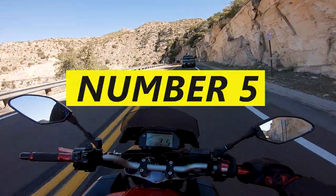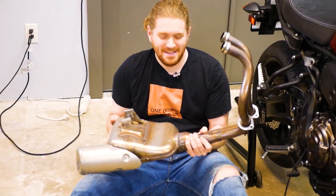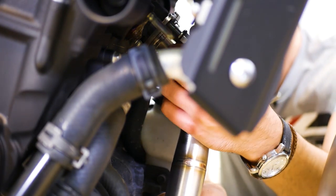This goes hand in hand with my next point, and that is simply to think. Before you pick up a tool, think: what am I doing? What am I trying to accomplish? Or what will happen if I remove this bolt? If you're installing a full system exhaust on a modern sport bike with a one-piece exhaust system like the CB650R or XSR700, pulling that last supporting bolt out will cause somewhere between 15 and 25 pounds of metal to come crashing straight down. Is your hand clear? Is your head? What about screwdrivers — is that a JIS screw or a normal one? Does the head match the bolt? These are a series of mental checks that you should do every time you turn a wrench. It might seem like overkill, but you'll thank me next time simply pausing to think before going full send on a wrench saves you time and pain.